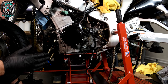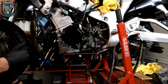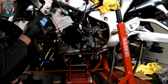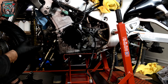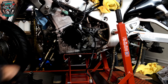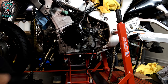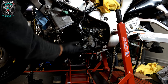Most of that was probably fast-forwarded so you didn't see all the jiggery pokery. Every bike and install is different, but in this instance the easiest holes to line up initially were the two fronts — I've got a bolt in here and one opposite, so now whenever I go up and down on the jack it pivots from that point and I can line the rest of the engine bolts up easily. As long as you can get one bolt in, you can then manipulate the engine and get all the others in without too much faff.